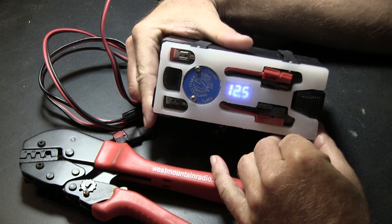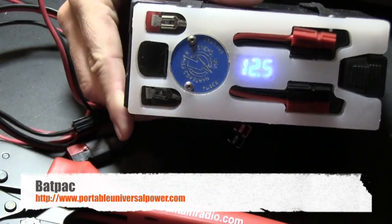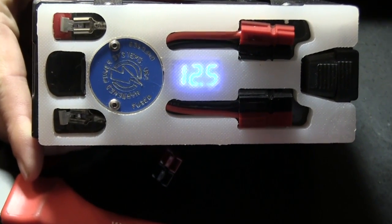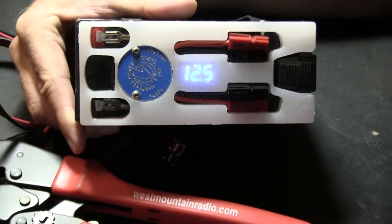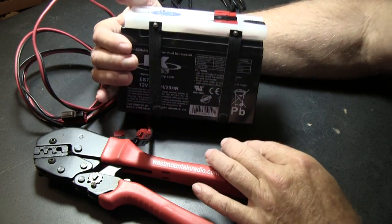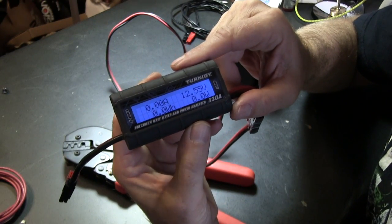Guys, this little thing from Hardin Power Supplies will turn your 12-volt motorcycle battery into a power pole distribution box. It features one 12-volt switched power supply, one unswitched power supply, both on power poles, and a handy little digital watt meter that'll measure the battery output. The unit is securely fastened to your motorcycle battery by Velcro. Hey, how simple.